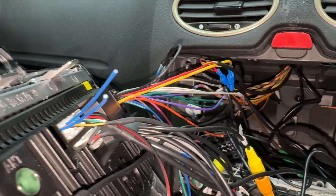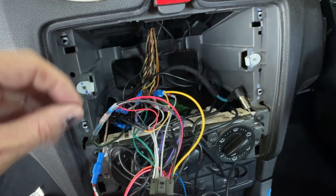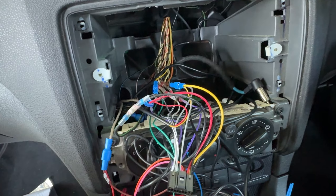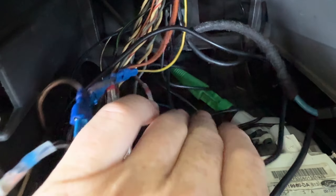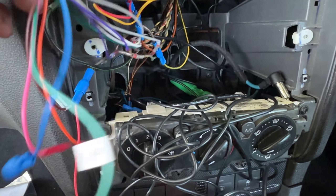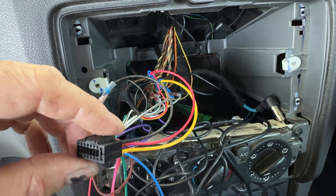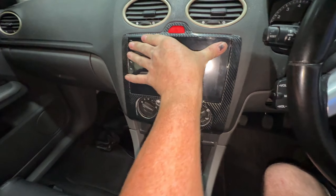The stereo is all connected up — we've got our power run for the reverse camera. We'll tidy all these cables up and make it a bit neater so we don't have anything dropping down, because there's a mechanism here with cables and mechanical remote items. We don't want things dropping down there and seizing it up — when you go to change your heater controls it could bind up and damage something. We'll tape all this up, get it cleaned up, and then push the stereo back in. The installation is pretty simple — just a matter of lining it up and clipping it in.